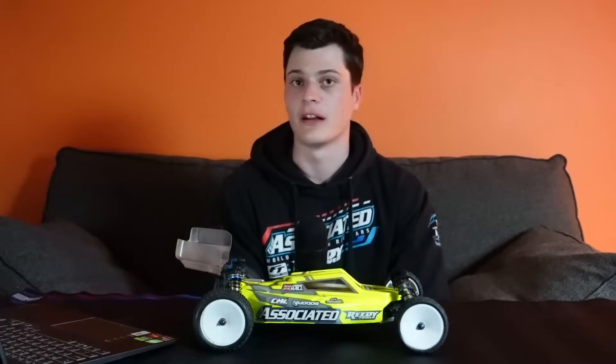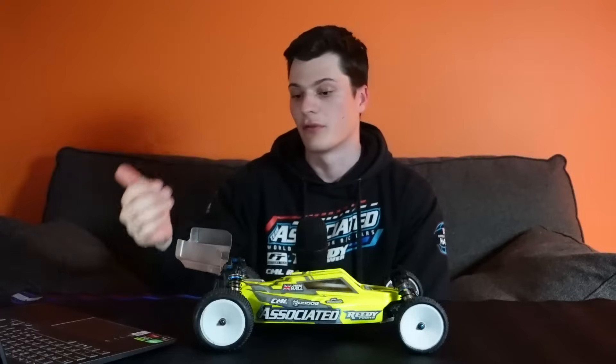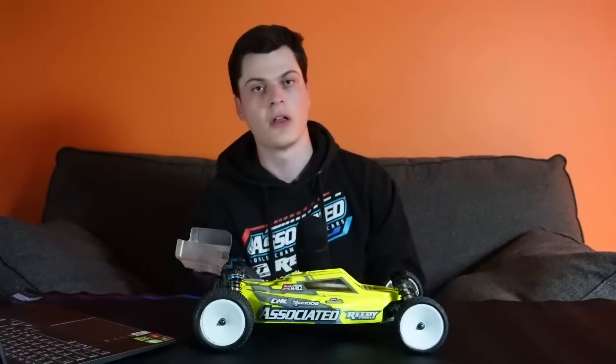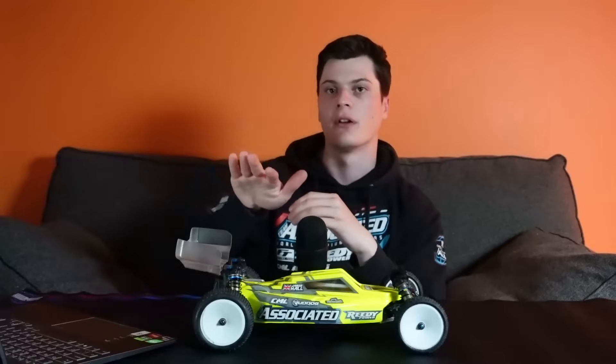In the middle of the corner with a lower hub, the car is going to rotate less. That's where you really notice the extra grip or less grip from having a higher or lower hub - because with the lower hub the ride height stays lower, and because of the lower roll center you've got less load transfer at the back and you're overall going to generate more rear traction. Coming out of the corner there isn't a huge difference, though occasionally raising the hub can make the car feel like it drives straighter out of corners, perhaps because it's rotating more in the corner. The big overriding factor with the rear hub is how high the car rolls coming into the corner and how much rotation you have mid-corner. To summarize: lower hub, the rear sits down more into the corner with more rear traction mid-corner; higher hub, the rear stands up more into the corner and the car rotates more mid-corner.